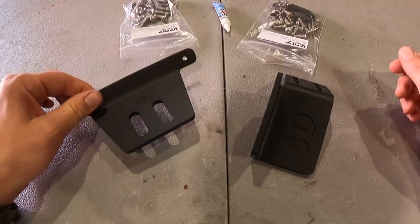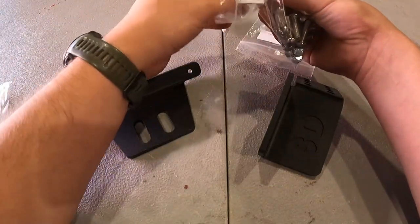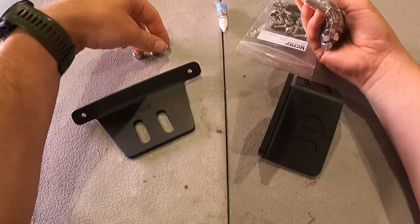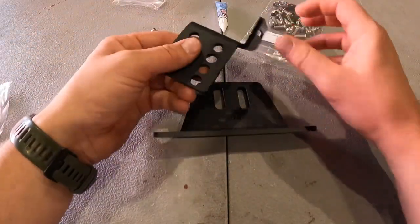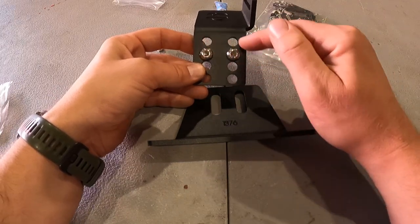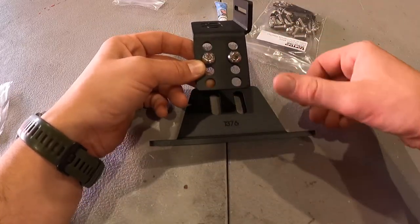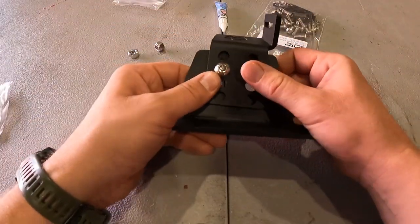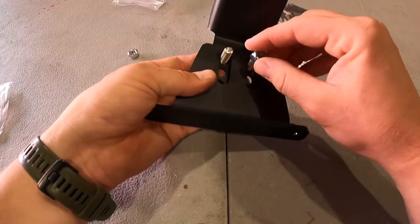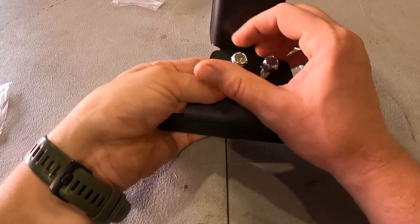We have our bases and our load bar clamps. First thing, grab two bolts and two nuts out of the bag that says feet to rack — these are going to be M8 button heads and M8 nylocks. We're going to take these two pieces and mate them together: throw one M8 bolt through the second hole on the foot — one above, two below. We're going to set every bolt in the second hole for all six feet, then put those bolts through the slots in the 1376 base, flip it over, and get our nylocks started. Because these are nylocks, you'll only get a couple of turns and then they will stop spinning.